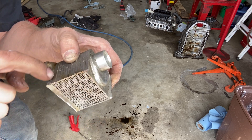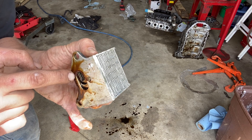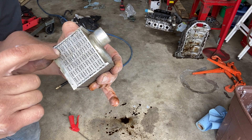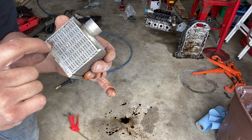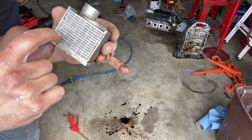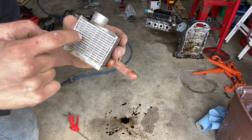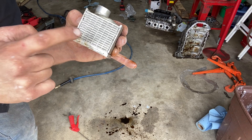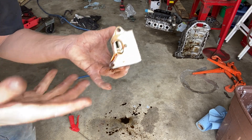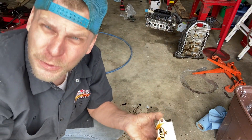The coolant flows through these channels right here and then the opposite sandwiches. The coolant will flow through the stacked sandwiches — so like: oil here, coolant here, oil here, coolant here, oil here, coolant here, and so on all the way up. So if any small little part of this thing gets a hole through it, it's going to mix the coolant and the oil in this cooler and push out a mixture of junk.